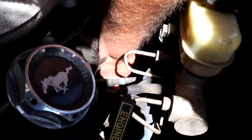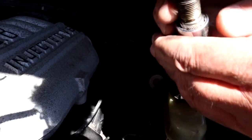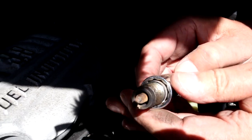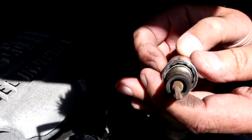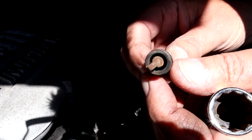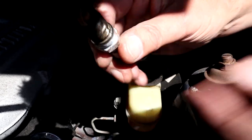I've left the rest of the plug leads attached because I'm not confident enough to just unplug every single plug lead and then put the right new ones on in the right order. How far do these plugs go? Oh, that might be it — yes. As you can see, the end of that is a nice tan color — it's all dry, no oil on it. So these plugs are actually in really good condition, other than the fact that they're a bit old. At least we know the engine is running really well. I'll just get a new plug ready.